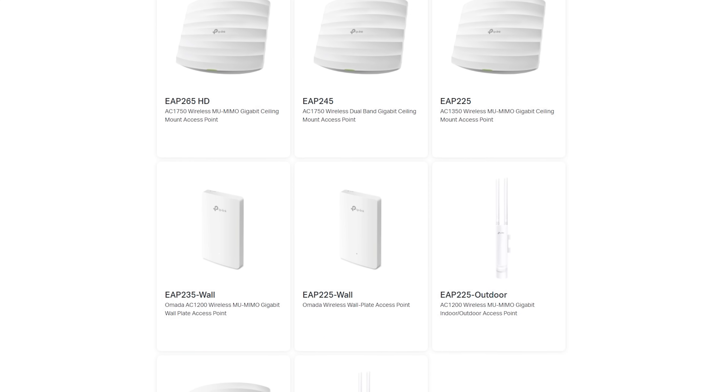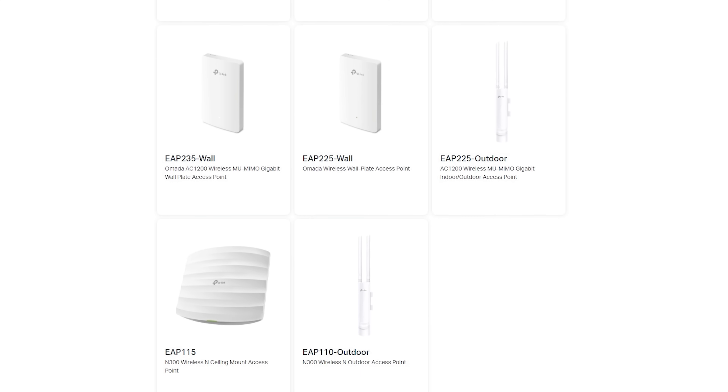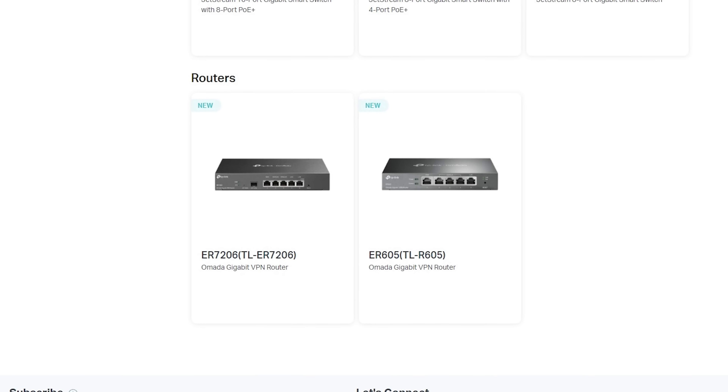I guess if you're just building out a network for IoT devices that wireless end stuff could be helpful, but it's not really super useful in the home. They also have two models of routers. Their routers are very similar to the USG in that they don't support multiple WAN IPs on a single interface, and they also don't support MDNS as of right now. They are working on that — I was in a meeting with TP-Link, their marketing team and senior product designer, and they said they're going to work on MDNS and hopefully it should be implemented via firmware update by the end of this year.